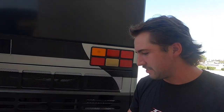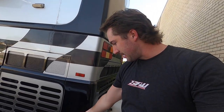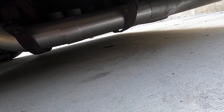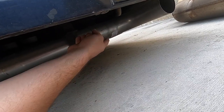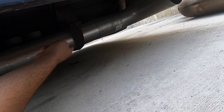We're back, day two — time to finish this exhaust. I just have to finish-weld the one piece I had to shorten yesterday and add the last extension piece that'll bring it outside the rocker, then make a bracket to keep it in that location. I'm going to leave the original basket bracket there so I can put the muffler back on. I'll make a bracket for the end to prevent it from rotating — that way it can't turn away from the bumper. That's the plan.